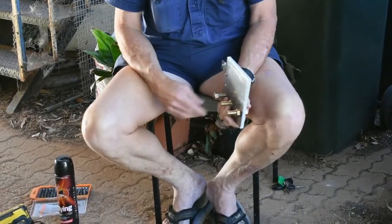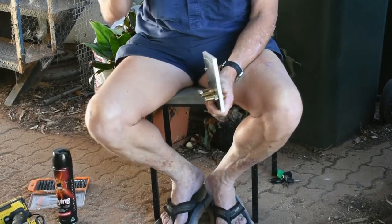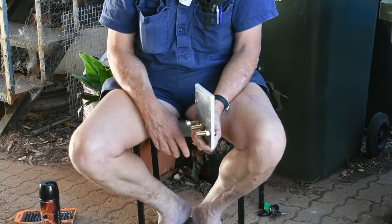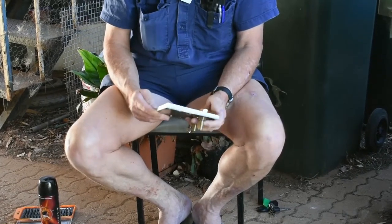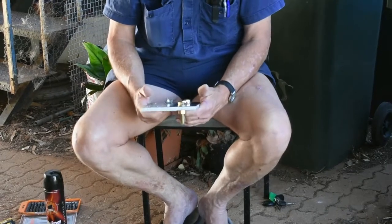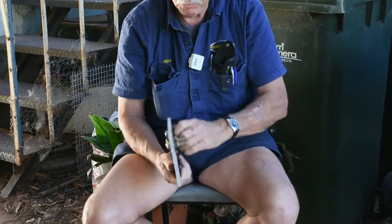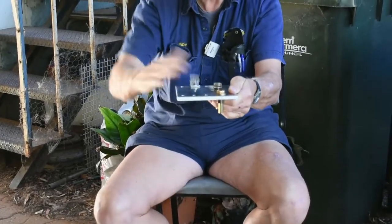So what I've done is I've got two plates. These are 10mm aluminium — which is just a little bit smaller than a half inch plate. I've got an alloy plate because it's more conductive and it's lighter and easier to work with. On the bull bar of my truck is a flat area similar to that, so all I've got is three bolts straight through the bull bar, bolt it up. That's as solid as a rock of Gibraltar.